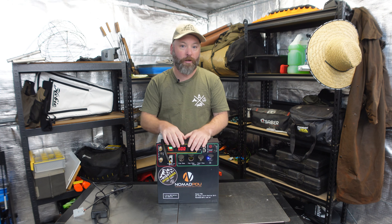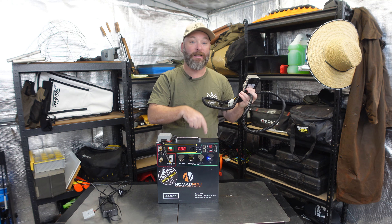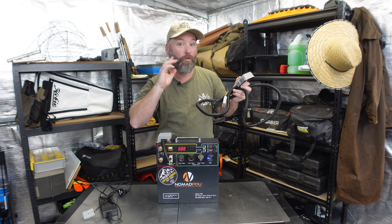When you're using your DC-DC chargers, I've also got this 10 amp DC-DC charger here. The reason I've got that one is that if I'm using my travel oven, I'll plug this one in to maintain the charge of the Nomad PDU whilst I'm on my way out. That means I can have my travel oven essentially running in the back of the car whilst the car's running, constantly charging it and keeping the battery topped up.